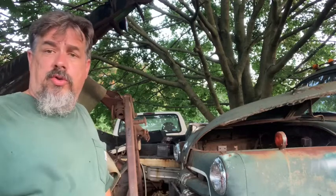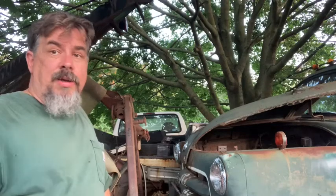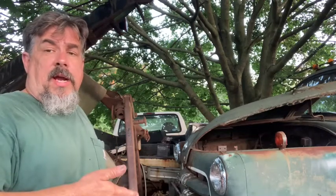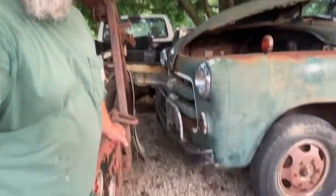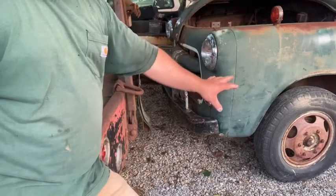It's a 305 standard bore, but it's fresh. Head's been done, crank, blah, blah, blah. It was going to go in a little Toyota truck that I had here, but I've since sold the Toyota truck, and the motor's built and done. Why not use it? So I may use that with a Turbo 350 trans and figure out what to do with these god-awful wheels.